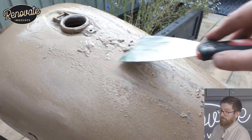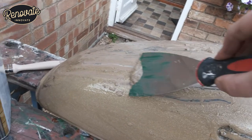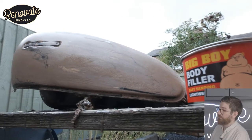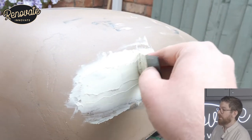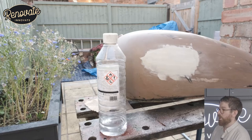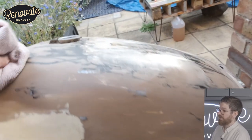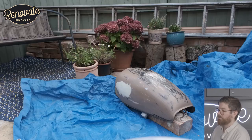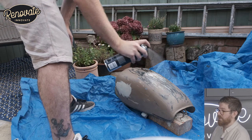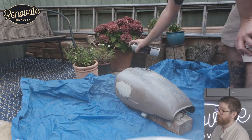I could have gone down to the bottom of the metal, but I'm hoping I can get a nice smooth finish and get the vinyl over the top. So I'm putting some body filler on here — there was a tank emblem on there with the Yamaha logo, and I didn't want that on this tank, so a bit of filler to smooth that bit over and rub it down. I'm using a bit of white spirits to clean off all the excess bits after rubbing it down, trying to get a clean coat as best I can. Then it's putting the primer on — I'm using an etch primer, building it up in thin layers to try and get an even coat over the top.